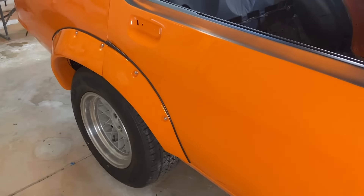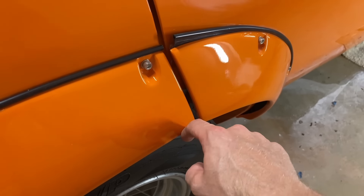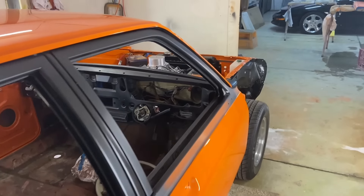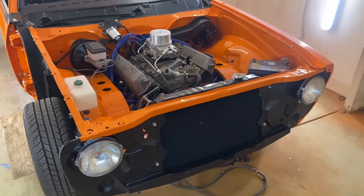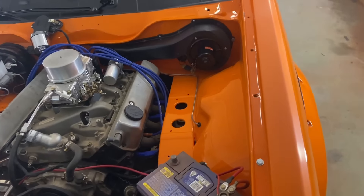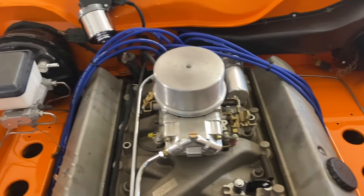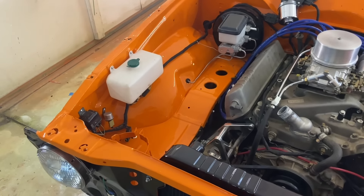It was already cleaned up before and painted black with a brush, but now it's got some sound deadener in there — it's nice and clean. I've sat the flares on there and there was a little bit of a gap that was a bit funny, so I've just sat a rubber under there to try and even out the gap as it had a bit of a dip in it. We might have to glue it up here as there is no bolt up higher, but it's starting to look good. The car is getting there. The engine bay is now painted — it's nothing over the top, only meant to be a cruiser. I've cleaned it up the bare minimum and put it back nice and neat, the way it would have been from the factory but a little bit cleaner. A lot of the wiring is hidden where we could, factory brake lines run through the factory holes, heater box all cleaned up. Had a spare wiper motor cover that was chromed from when we did the hatchback.